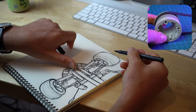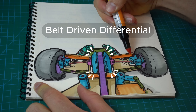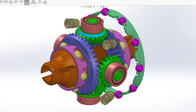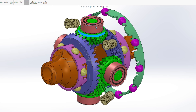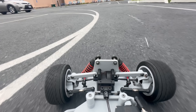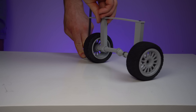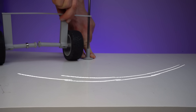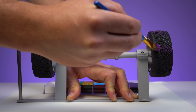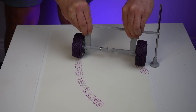It's simple to imagine designing a gear that could be 3D printed and mesh with a timing belt, but it became immediately apparent that I'm going to have to redesign the differential to work with a belt. The differential looks really complex, but at its foundation, differentials are extremely simple. When a car turns, the wheel on the outside traces a larger circle and has to travel a farther distance and spin faster than the wheel on the inside. We can see this really clearly by painting both wheels and tracing the path they take during a turn on a sheet of paper.